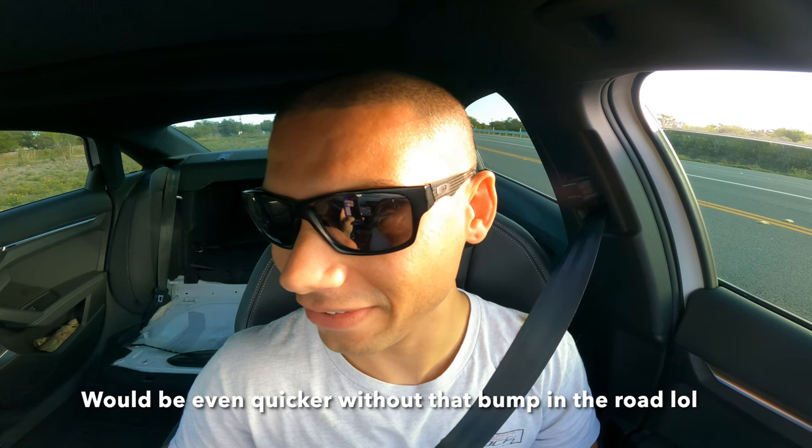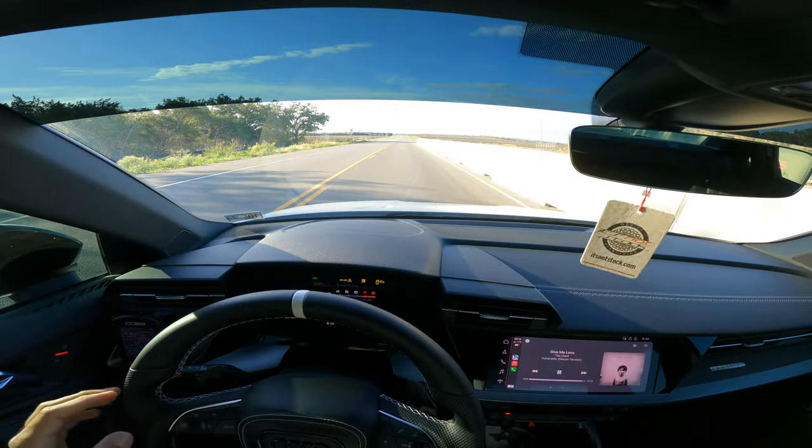Now I just aired back down the tire pressure — it actually went up like 3 PSI on that two-mile drive. Airing them back down all to 22. We're gonna flip around and let's pray we get traction. I went through VCDS, did what I could — reset of adaptations, primed the pump and stuff, so hopefully that helps.